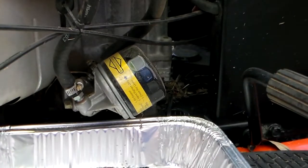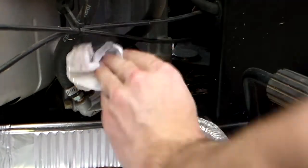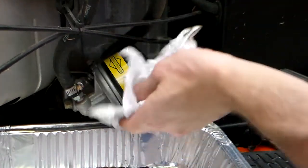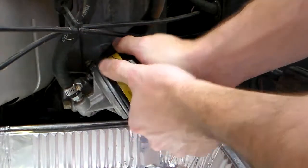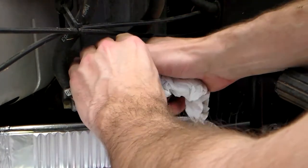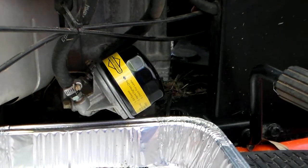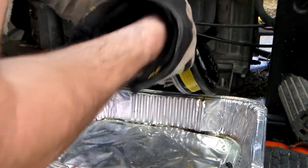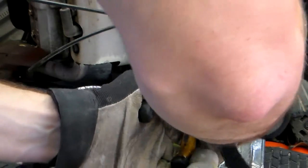See how hard this is to get off. I'm just going to put a catch pan here and wipe this off. It can get really tight — it's been on here a long time. I don't know if I have an oil filter wrench, let me go check. I actually tracked down a filter wrench, which is really exciting. I'm just going to grab this and apply a little bit more torque — and it comes right off. Very good.